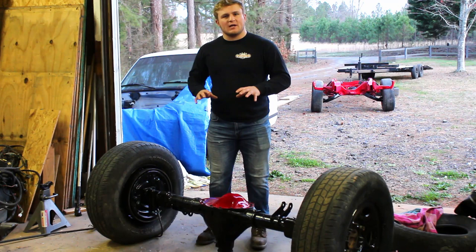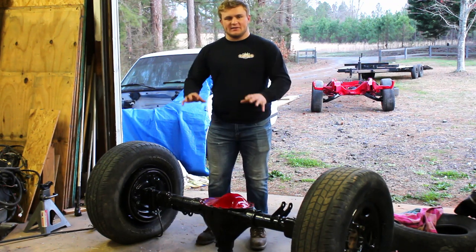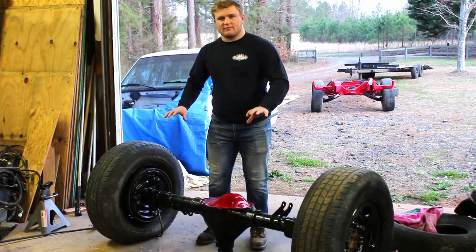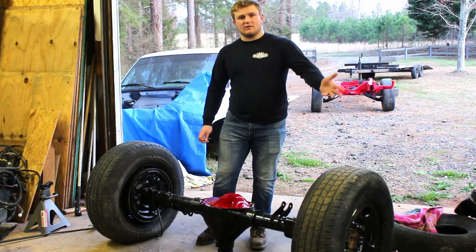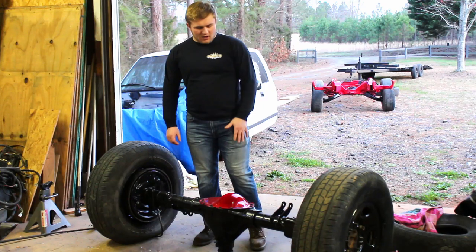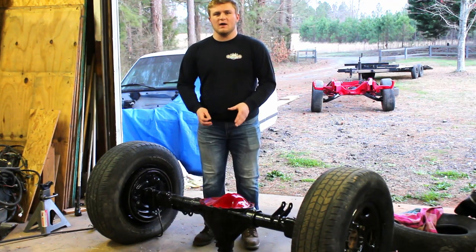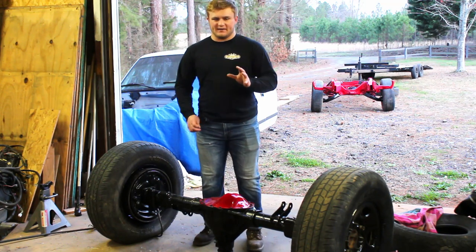In this episode, we're going to be rebuilding a 9.5-inch GM 14-bolt axle. This axle is the semi-floater as compared to the full floater, which is the 10.5. In this video, we're going to install a Detroit Truetrac limited slip differential and some Yukon 410 gears.